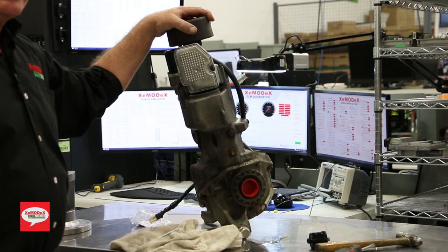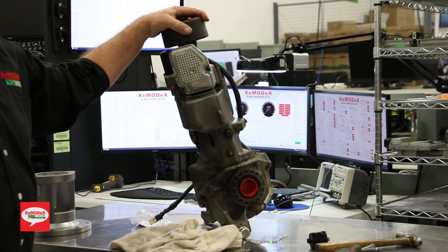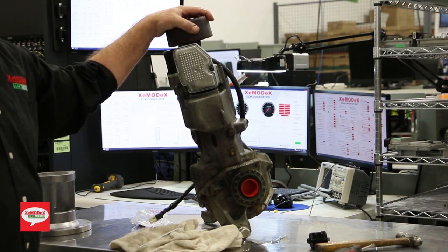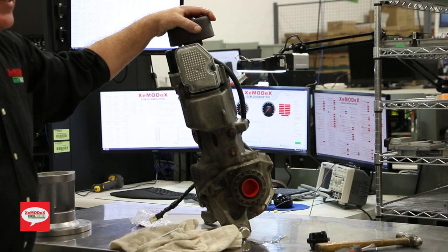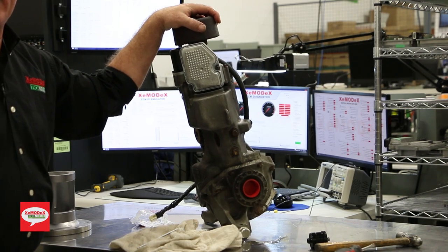But even with cases like that, we've actually had DEMs get destroyed. 90% of our repairs are a result of failing pumps. The other 10% are basically network interference or water intrusion, where it just shorts out the unit. Typically, a blown fuse is a really good example that you've got a bad pump.